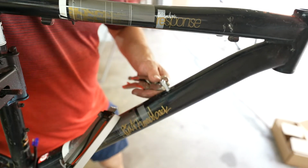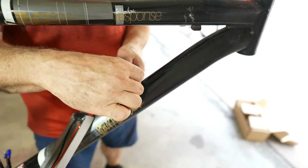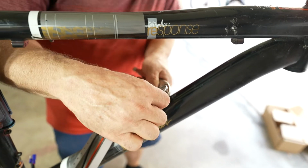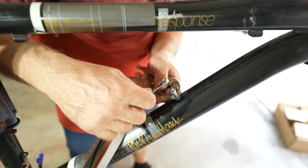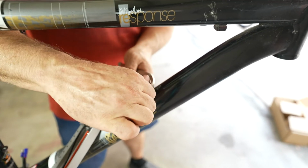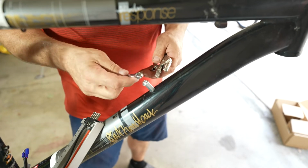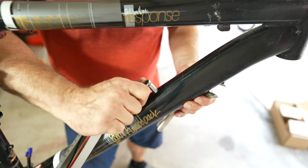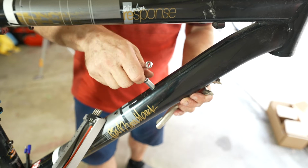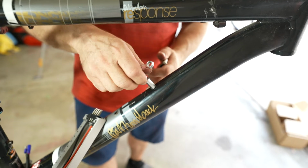Oops, let's tighten that up. So I'm going to press it down in a little bit, and then I'm just going to start turning this nut, and you'll feel resistance. It should be smashing it, and the bottom part should not be turning. And we just want to cinch that up until it's a whole new level of resistance, and it's perfect. Don't need to go too tight. Now we can take our insertion tool off. If you need to, you could reload it. Put another nut in if you have to put one in a different spot.